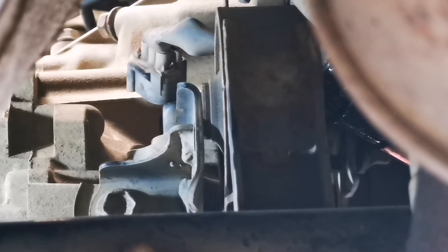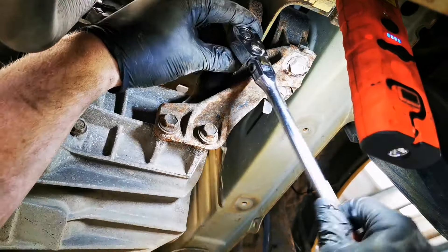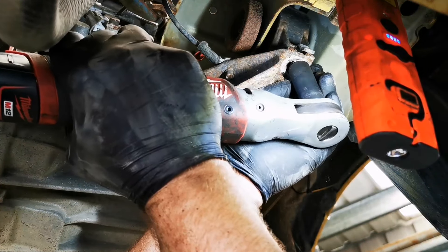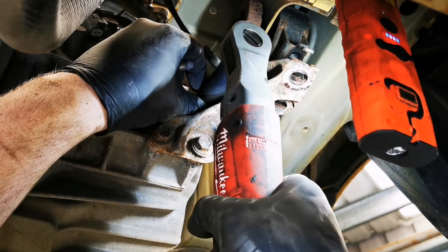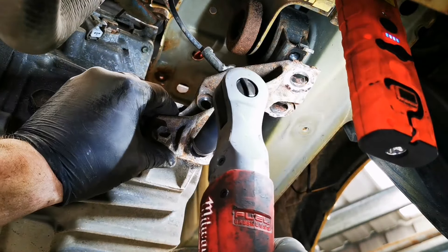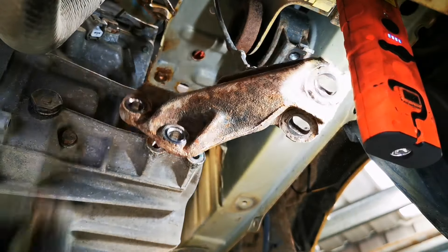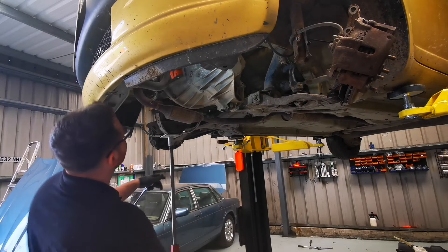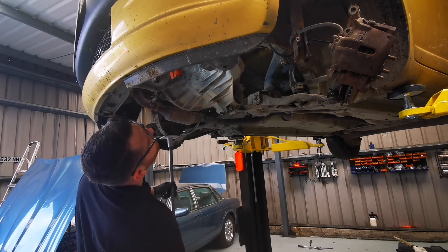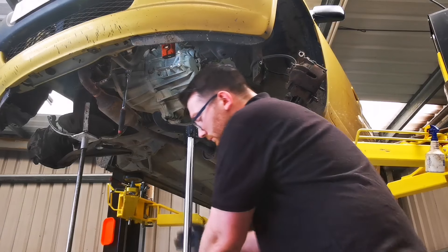Be careful removing the rear stabilizer — as I said before, when you remove this the engine will tilt slightly. When we're ready we can start to remove the gearbox mount. With this removed, all of the weight will be on our engine support so we want to make sure that is right before going any further. With the mount hanging loose, we can just tuck it up out of the way and it can sit on top of the battery tray. By supporting the engine from underneath it means we can adjust the height of the engine down slightly just to make removal a little bit easier. A quick visual double check to make sure nothing else is in the way, and then we can remove that last bell housing bolt and remove the gearbox.